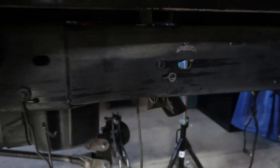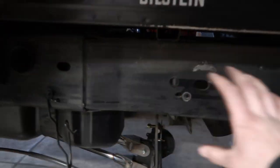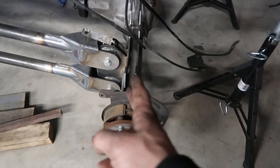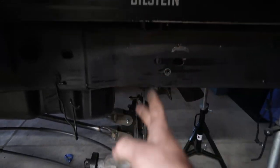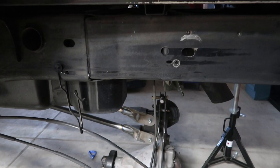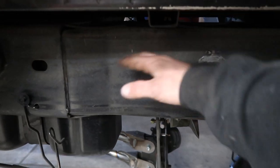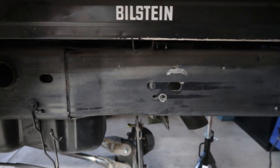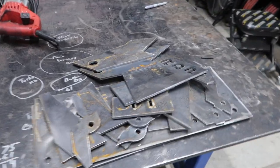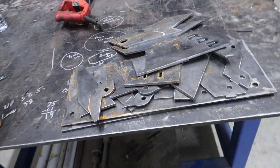I think we're gonna shift focus and start building the back out. I already took the bump stop off and all that stuff. We're gonna start plating this part of the frame. We already have everything cut out — we'll set our coilover tower where we want it, in line with everything, make sure everything's squared up, then measure it, tack it on, get our heights, then weld the whole thing. It should be fairly easy — just a couple plates, nothing to it.